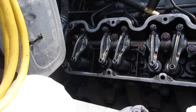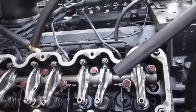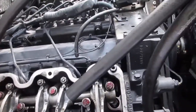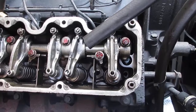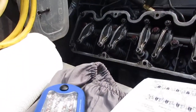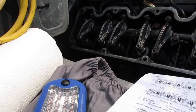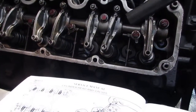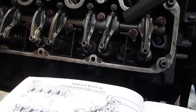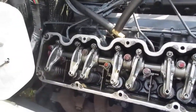This whole bank right here — on the even side bank we can adjust two, four, and eight. So two right here, four and eight on the intake sides. Eight on the exhaust — so that one right there might not be the one we can adjust right now. This is the one we've got to worry about, but it's not always released so I've got to spin the motor over and get the rest.